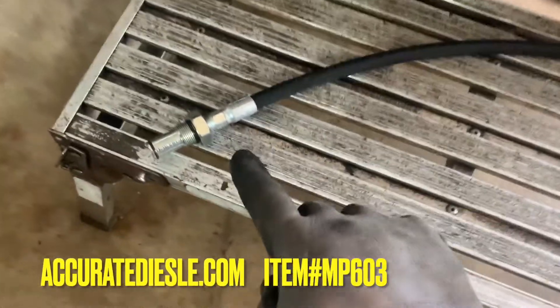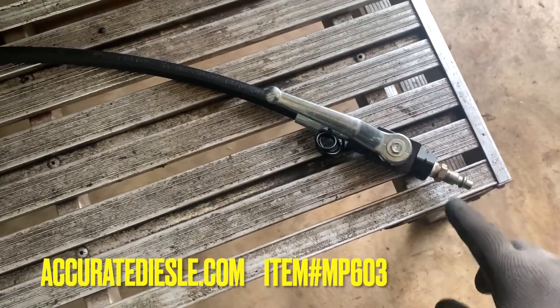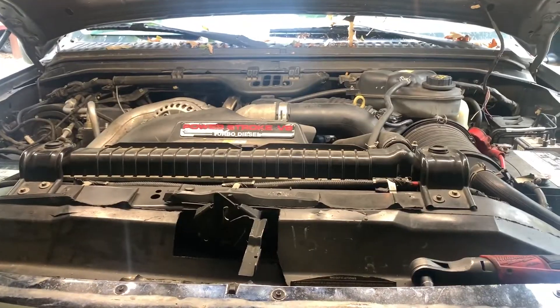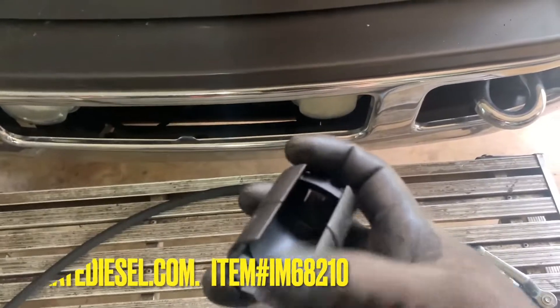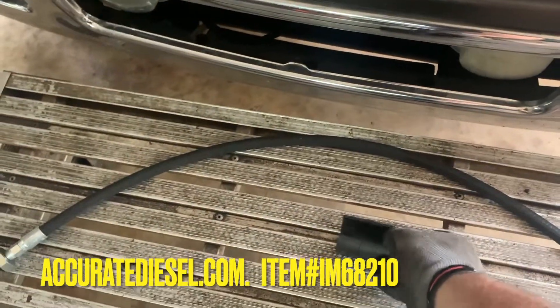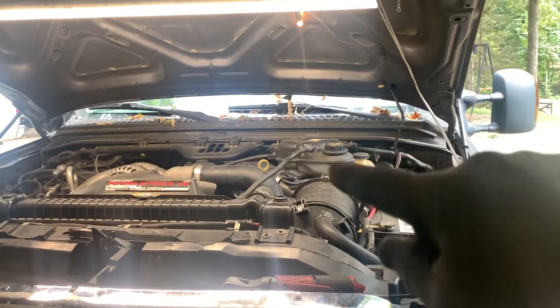It's better than going through the ICP sensor. Let me show y'all this from Accurate Diesel. So this is your IPR test tool — it screws into the IPR, it's got this really nice valve on it, you just hook your shop air to it. It takes the IPR out of the loop and provides an even amount of air to both high pressure oil rails on each head to test the system and find where your leak is. I'm also using this IPR socket from Accurate Diesel — first time I've used it, it'll be nice having that with the turbo on. Let me show y'all real quick what you remove to get to it and how this goes.